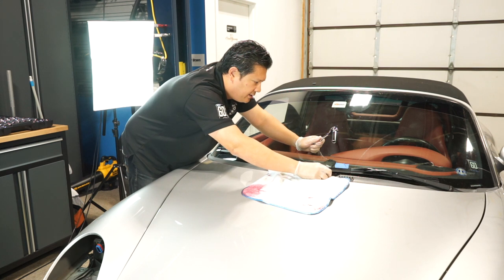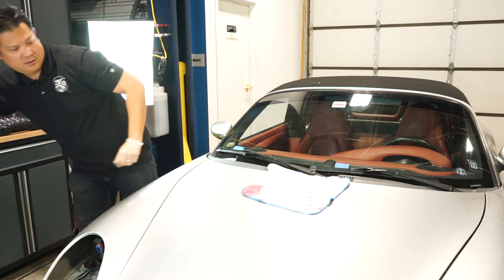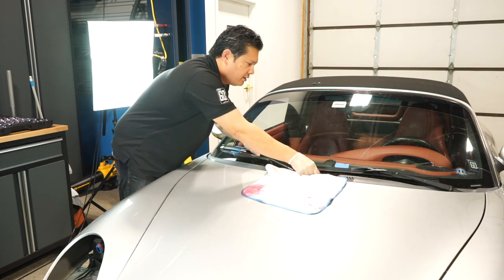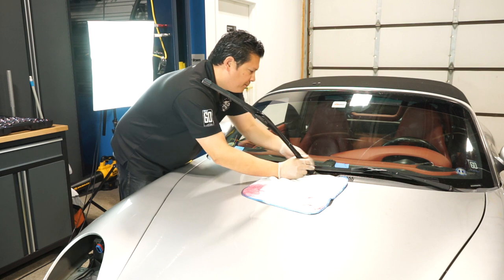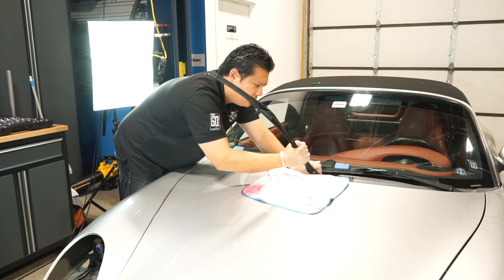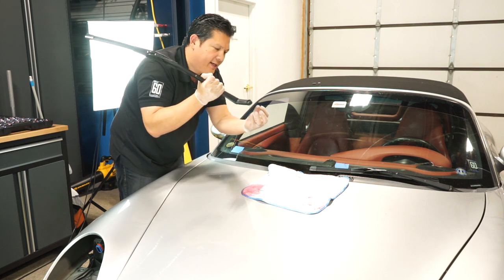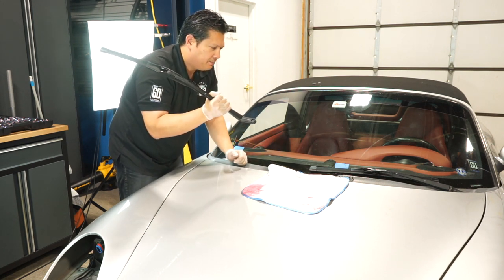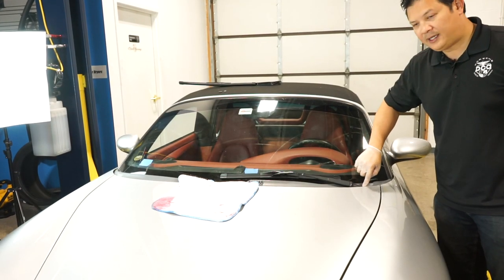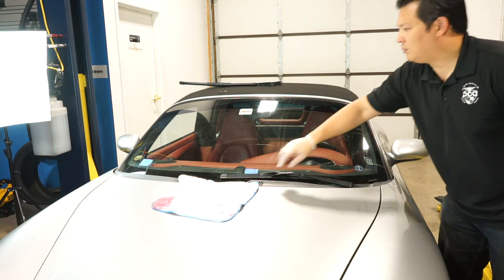They're not on very tight. To remove them, they're on there with a press fit, so you're just going to wiggle it out a bit — wiggle it and they'll come right off. They're just press fit; it's a cone seating surface that as you tighten it down, it tightens the wiper in place, but other than that it comes right off. For this side, you're going to have to get to this nut with the hood open and then carefully pull the wiper off.